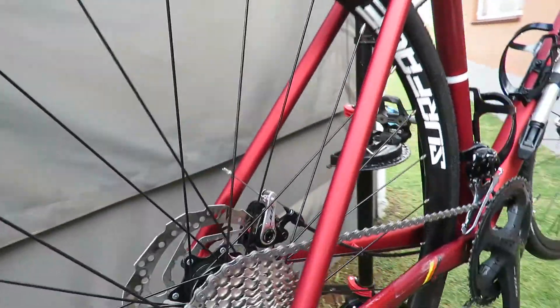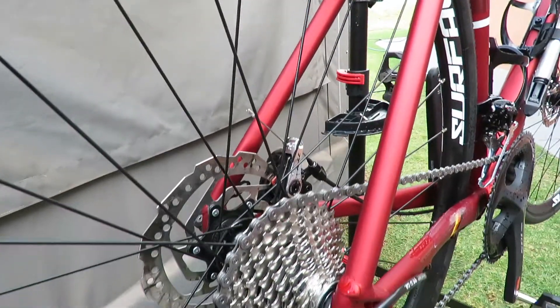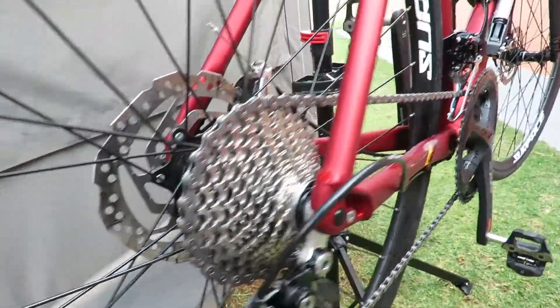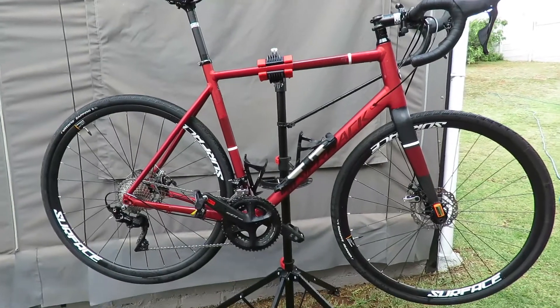Before you apply any lube or oil, make sure everything is dry first, otherwise the water will just wash it away. If you have any alcohol to put on the disc brakes — I don't have any yet but I do want to do that — just to make sure it is completely clean. Otherwise, just try to wipe it down with a clean cloth and not any chemicals. You can see the cassette is pretty spotless and the chain is very clean. So I'll wait for this to dry before I put any chain lube on. That's just a very basic rundown of how I clean my bike — just a normal clean to keep the cassette, chain, and frame in good working order. If you have any tips on how to make this quick bike wash even quicker, let me know.